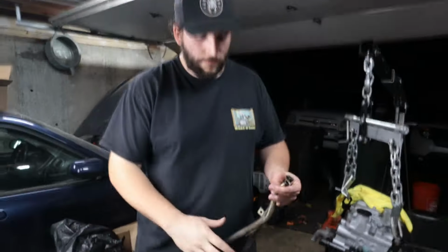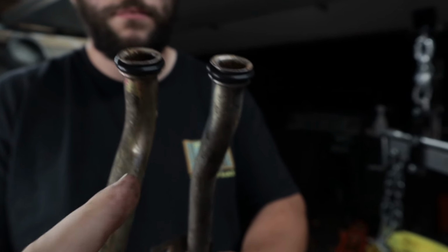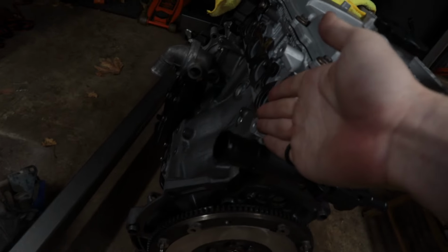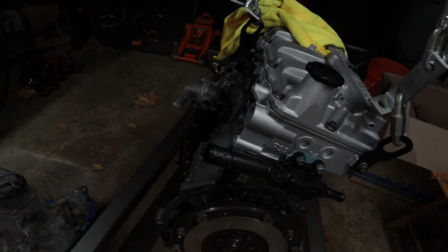Here's the dilemma that we ran into. The XD clutch kit didn't come with new pressure plate bolts. Tomorrow, Brad is gonna stop back by in the morning, and before we start recording, I'm gonna find the bolts. But luckily, in the meantime, we have a couple hoses. We had to get these new O-rings, and they fit on there very nicely, so these have to go into the thermostat housing, and they kind of run alongside the engine block and somehow fit behind the turbo and exhaust manifold. We don't know what we're doing. We're trying. Amateurs.